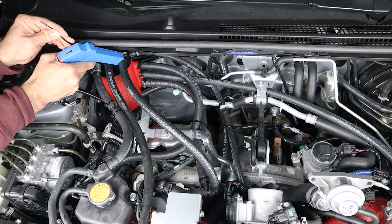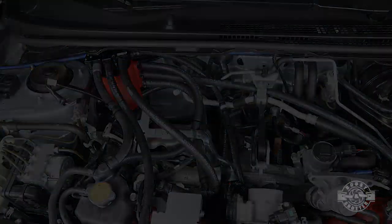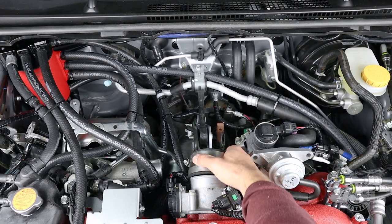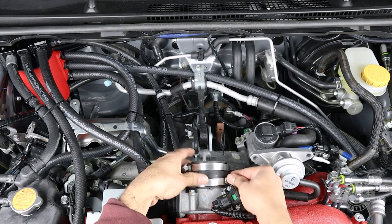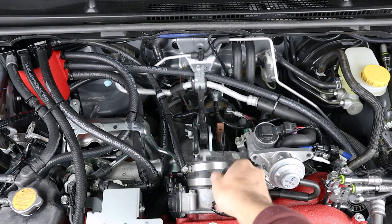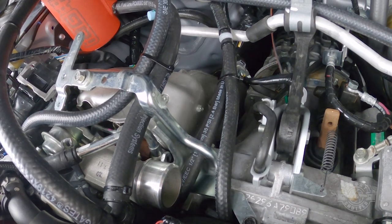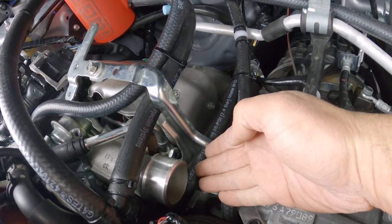You may think that final hose is too short — and you'd be right — but let's finish the install and then I'll tell you why and what I did about it so it doesn't happen to you. This cable right here might end up kind of loose — you're free to move it and secure it with a zip tie. Grab the coupler and put it back on the throttle body, secure it with a wrench — torque to 2.2 foot-pounds. We're about ready to put the intercooler back but there's a little issue you may come across.